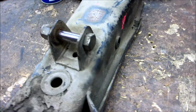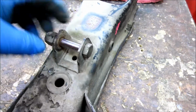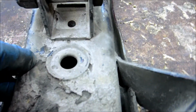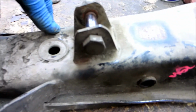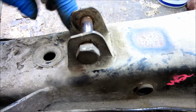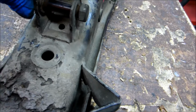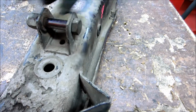All right, quick little addition here. The shock mount. I'm talking about relocating that so that the hole is up, back and behind here. Okay, now if you can see this in the video without me getting everybody seasick, it sits down inside a dimple here, and the hole there is for water drain collecting in there. So they stamp this piece out, and then they fully weld it down each side.